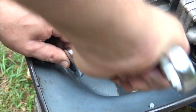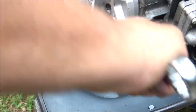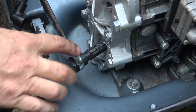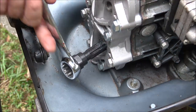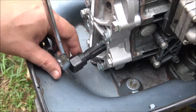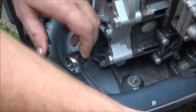We're getting pretty close — it's been about 10 minutes. It's starting to feel like it's screwing in. I just held my thumb up against there and kept turning it, cleaning out the threads, turning it, cleaning out the threads. It feels like they may be cutting now. It's a 13/16ths wrench — it will fit on this way but it won't fit that way. Weird.